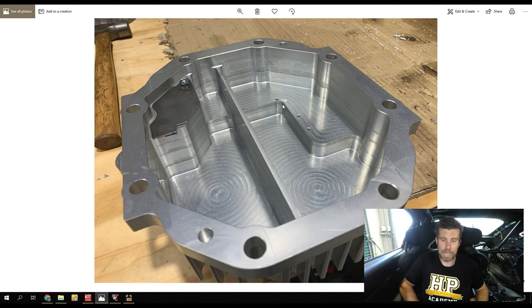What I really wanted to show was this Cusco rear diff cover — an extended billet alloy Cusco diff cover. What it does is extend or increase the oil capacity by about half a litre. The problem though is we have this 90-degree angle here, and the same happens down below where we can't see.